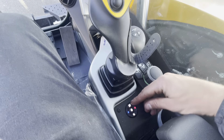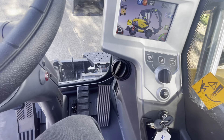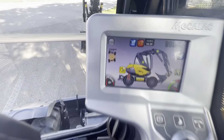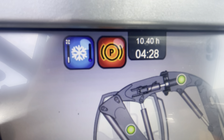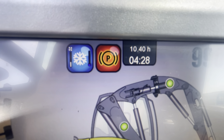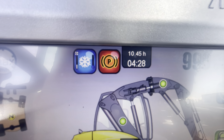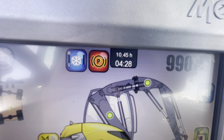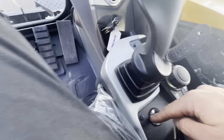And then we've got your air con control. So a little tip: when you've got the air conditioner on and you go hot, you see that little blue that just came up? When you come back down, it looks like you've turned the hot all the way off but it's still got a little bit on — that keeps the heater valve open so you're still going to get hot air. Just make sure you go all the way down by pressing the cold button. Something we need to update in the software. Make sure the heater valve is all the way closed, then you'll get nice cold air. To turn the fan off, just press the fan off button.